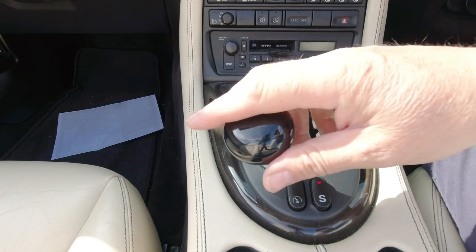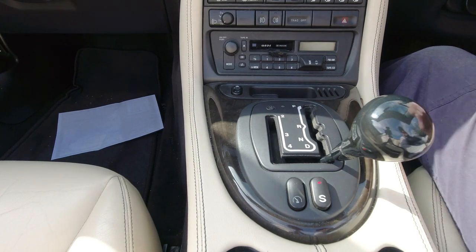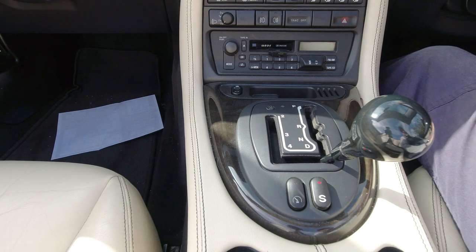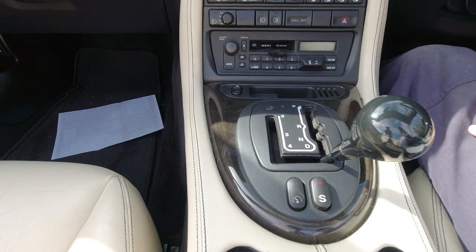So if I'm approaching a steep downhill, I can see I'm going to be going downhill for some while. I may be in a queue of cars going down there. I don't want the car to just get faster and faster and faster. I don't want to ride for half a mile with my brakes on. They're going to burn out. I'm wasting my brake pads. I'm heating everything up. I'm glazing my brakes and potentially damaging them.